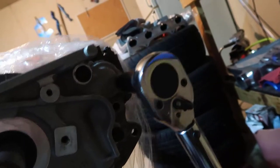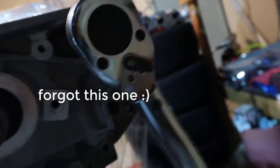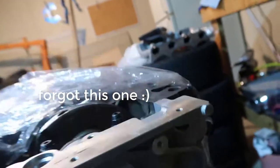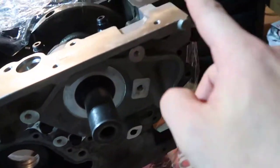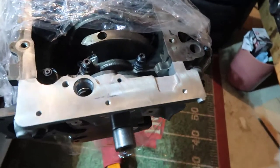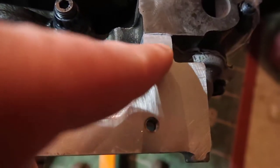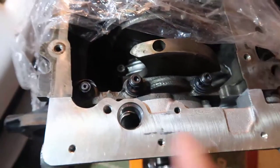So there you go. It's not, oops, 17 foot pound. Actually, this one was not torqued. I'm surprised because I torqued everything many times. And star pattern, I did this one, then went the other side, then went here, then went back and back. So just keep crossing. Yeah, so now you see I torqued a little more, and now more of the gasket came up. I'm going to take that out of there because there is the oil pan gasket that's going to be there.